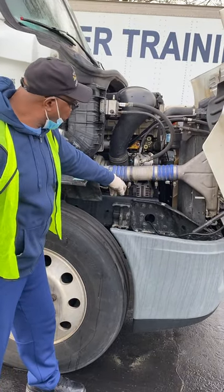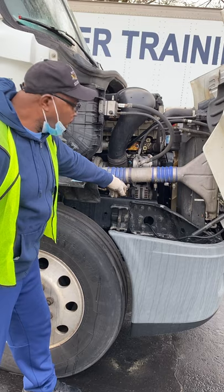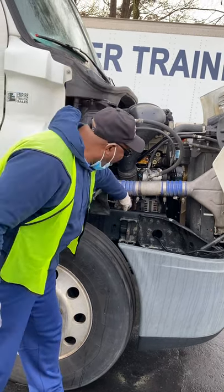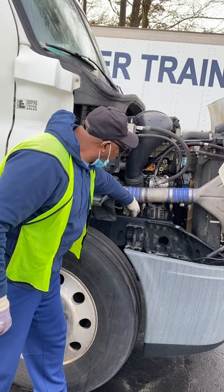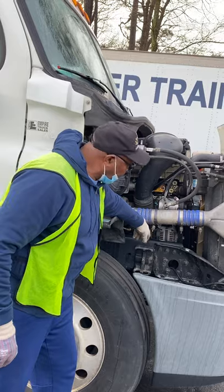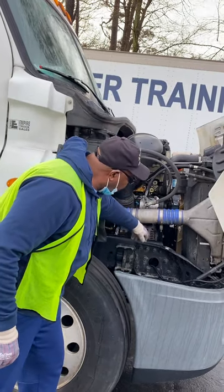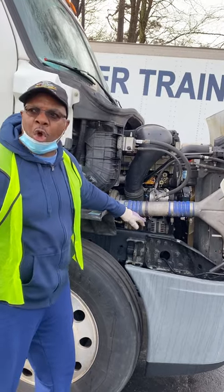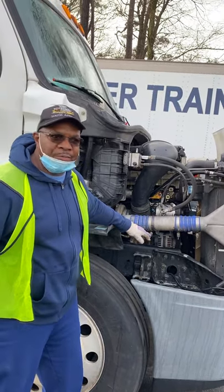This is the alternator. It's not cracked or broken, not missing nuts, bolts, and screws. It is belt-driven. The wire is not cut, cracked, or dry-rotted. There are no exposed wires, which would indicate electrical damage. This is the belt — it's not cut, cracked, or dry-rotted. The tension on the belt should be no more than one-half of an inch.